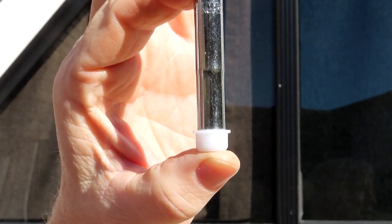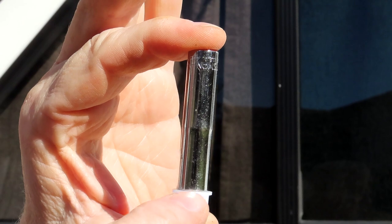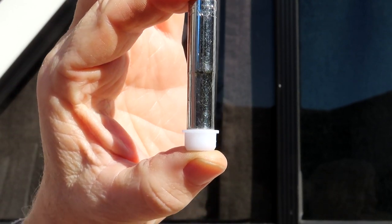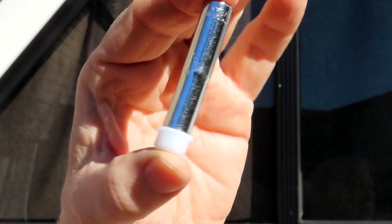So they go in a hole that's real tight, pretty easy. And it definitely scrapes apart a little bit of the side and stuff. But they stay there. And like I said, mine have been there 5 years. So that's a pretty nice way to fix the rubbing on the side of the A-liner.